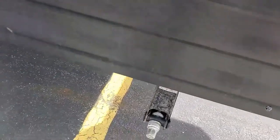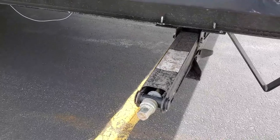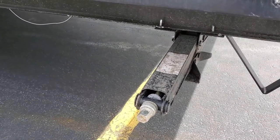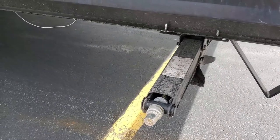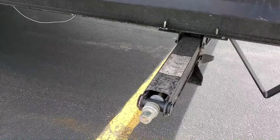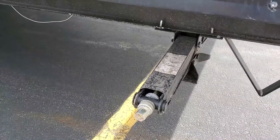You have four stabilizing jacks. Remember: these are stabilizing jacks, not leveling jacks. Get the trailer level front to back with the tongue and side to side with the leveling blocks, then put these down snug to the ground — they help stabilize as you're walking around so it's not as wobbly.